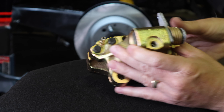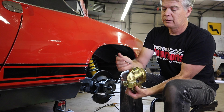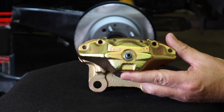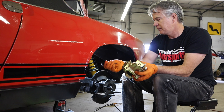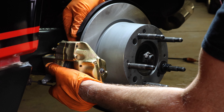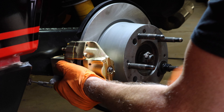That's the inside one. On the outboard side there's a lock nut and then another allen bolt that will move the outer piston in or out depending on clearance. Once you have the caliper installed on the car with the rotor and the pads in, you can use a feeler gauge to get the distance set just right.